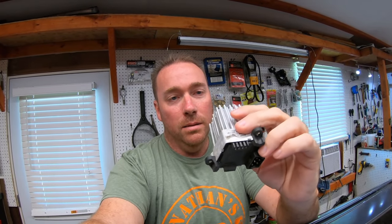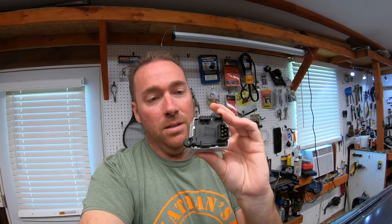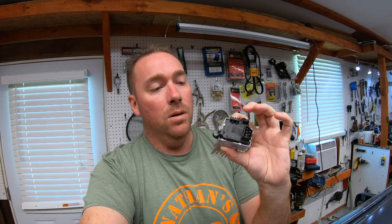This is what you typically see in German cars. Every vehicle has a different variant of this — whether it's Dodge, Ford, Chevy, whatever. It usually sits somewhere in the dash; on some vehicles it's attached to the rear of the HVAC unit. Inside there are little resistors and a little circuit board. What'll happen is it can get totally burnt where the blower motor won't work, or it'll arc out inside and stay on — and you may not notice it. All the climate control functions might work correctly but you're just experiencing battery drain. We've had several of these that would drain it over a span of about a day and a half. Instead of replacing it straight away, just go unplug it for a day and see what happens. Your HVAC fan won't work, but that will tell you what's going on.